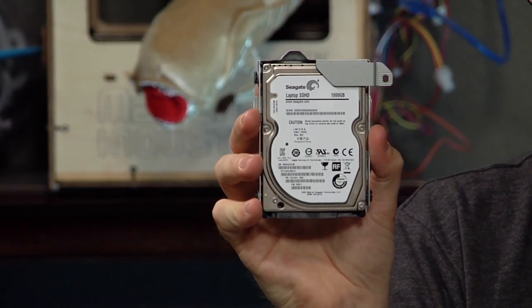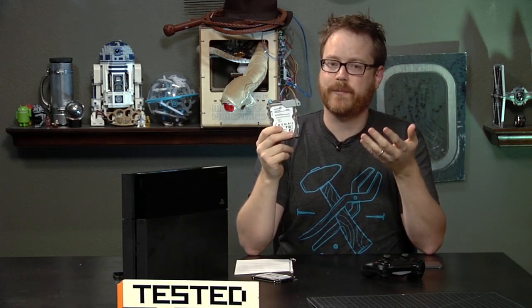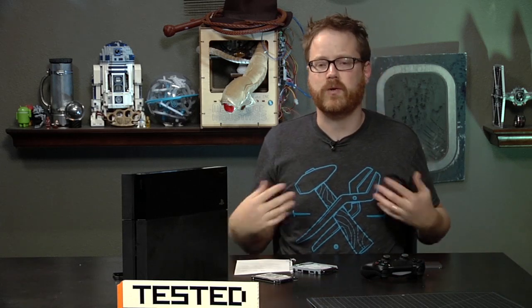Now the hybrid drive is a different situation. It's about $110 for a one-terabyte drive — that's twice the capacity of the default drive and also a lot faster. There are gotchas though: the first time you load any piece of content, it pulls it off the spinning platters of the disk, so it's going to be slow, just like the default 500-gigabyte hard drive. However, for stuff you use most frequently, it does actually cache that content on the flash memory. This particular drive has only eight gigabytes of onboard flash — you can get them up to 64 gigabytes, and the price difference is about $15 or $20.